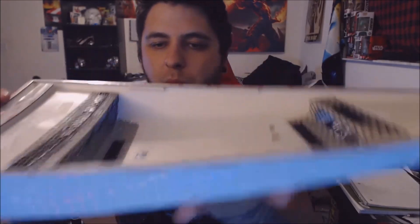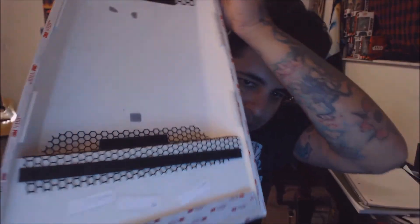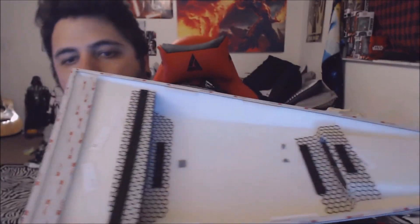I have a white car so mine are pre-painted. There's the underneath. When we put the 3M tape on, we just did it around the edge and made sure it was more toward the inside than the outside — if it's closer to the edge, you might see it when it goes on the car. So we tried to keep it as inside as possible so it wouldn't show on the edge and there wouldn't be a gap. That part is just folded under like I showed previously. You might have to pinch it a little bit to make sure it's down, but this isn't going anywhere — this stuff holds pretty hardcore.